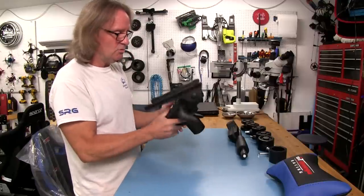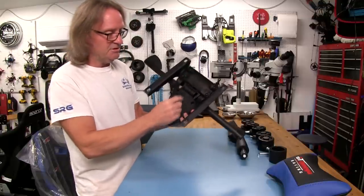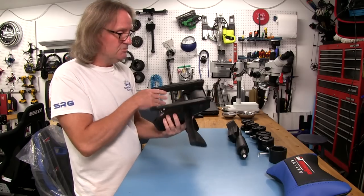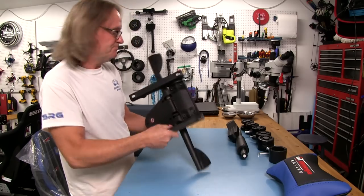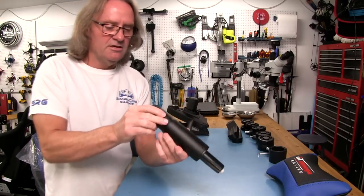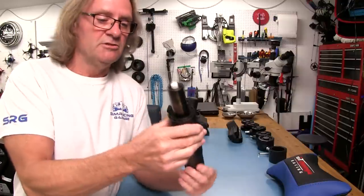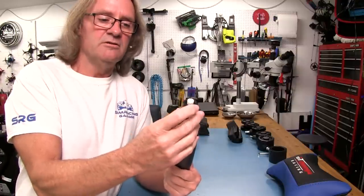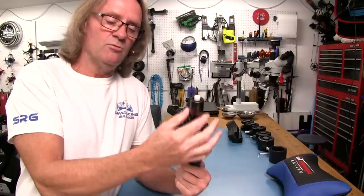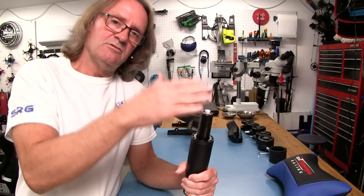This is all pretty much standard industry manufacturing from China. There are some plastic plates here, but in the back part where the hinges are, it's all metal or stamped steel. Now let's look at that piston. This is the usual thing we see in these type of chairs. This button here is where that lever we saw in that assembly is going to push down, and when you push down on it, it releases this — it's under gas pressure, so it's going to extend. That's what makes the seat go up and down.